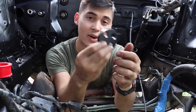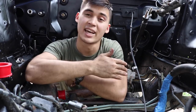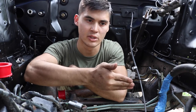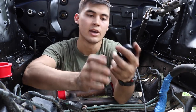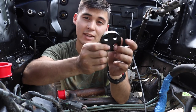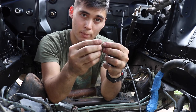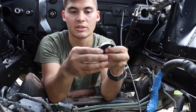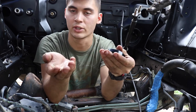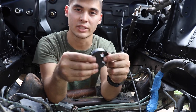I have done a video on installing these aftermarket bushings before where I actually dropped the subframe rather than dropping the steering rack, and I think I prefer dropping the subframe - I just remember it being a lot easier. But it's all based on personal preference - drop the steering rack, drop the subframe, or go from the interior. For a more detailed description, check out that video in the top right corner. One thing to note when upgrading to the aftermarket piece is that you're going to have to retain all your brass and plastic fittings from the OEM bushings. They fit in pretty easily - sometimes you may have to press them in, but both times I've done it they've gone in with finger strength. I ran one of these in my S13 for about a year and highly recommend it.